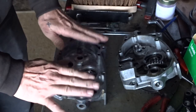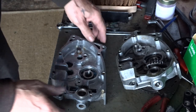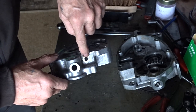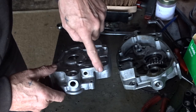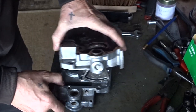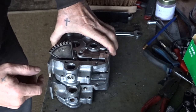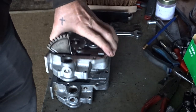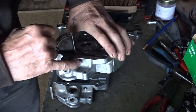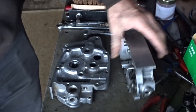So there's the new casing, and it shows the difference between the casings with the neutral switch and without the neutral switch. With the neutral switch you've got this 3/8 by 24 UNF tapped hole there, and there's a big chunk of ally taken out where that switch goes. See that where that bit of ally has been taken out and the hole's been drilled. On the one without the switch I've marked up where that switch goes as exact as I can, so that we can drill and tap a 3/8 by 24 hole in there, so we'll have another one for use of a neutral switch.